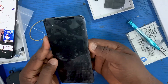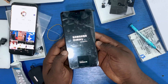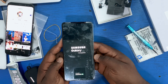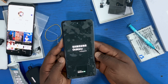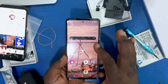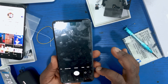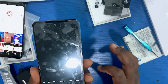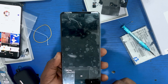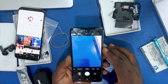After assembling the phone, this is the moment of truth — and miraculously, the phone actually came on. My other fear was whether the phone would boot up to the desktop, and it eventually booted and everything was working fine. But there was a problem: the cameras wouldn't work. If I tried to take pictures, all I saw on the camera app was an error. I had to remove the cameras and clip them again afresh, and after testing them again, all the camera lenses were responding accordingly.